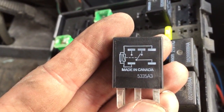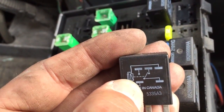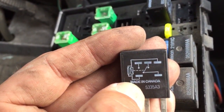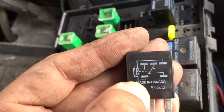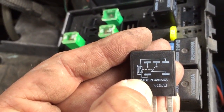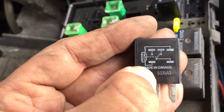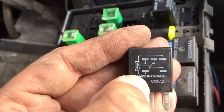So what we've got to do is figure out the relay — right here is the coil. I'm thinking there might be a diode in there, so if we put the meter on we should get a reading one way and not the other, which should tell us which sides are ground. I'm going to go ahead and dig into that right now and I'll be back.